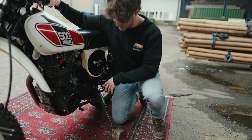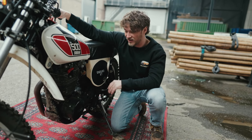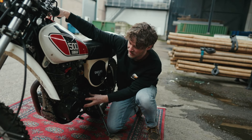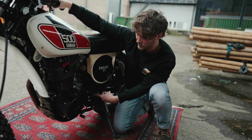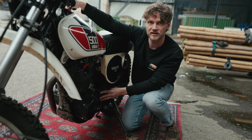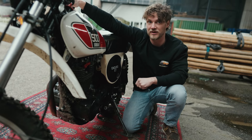Back in the day, chains often broke while riding, causing a whiplash through the machine and breaking everything they hit. Often these little bolt-on caps are broken, and you can even see the carter having a chip out because of this. So check if they are intact — otherwise you'll have to bolt those mounts on again.